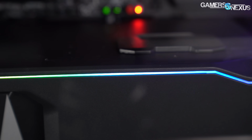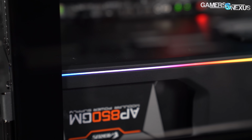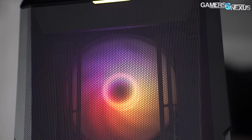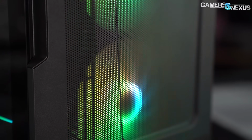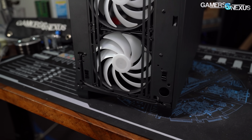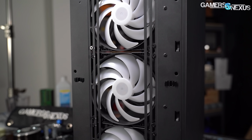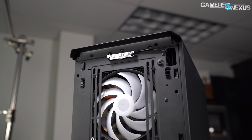Finally, it's time to get into thermal and noise testing. We stuck mostly to the usual test suites for this case. We had plans to do an additional test with the stock fans mounted to the front of the chassis to find out why Phanteks didn't use this configuration, but as we said earlier, we answered our own question when the fans didn't fit. Instead, we did a test with an extra 120mm exhaust fan tossed in, and a test with just 2 of the 140mm stock fans arranged in an attempt to emulate the stock P500A non-digital. To do this, we left the center intake fan alone, moved one fan to the rear exhaust slot, and then removed the last one entirely, just to give us one more representation on the charts.